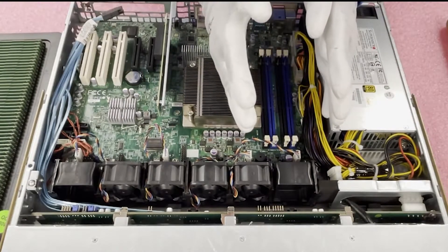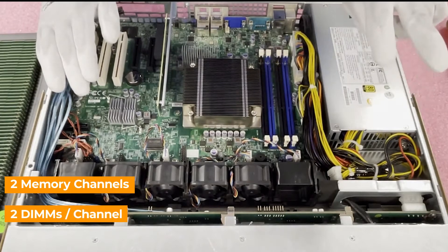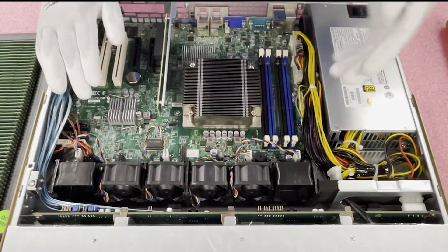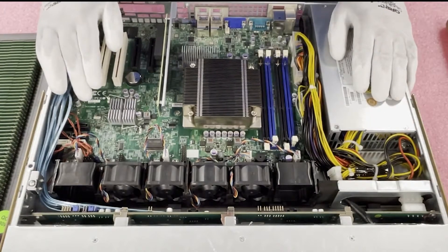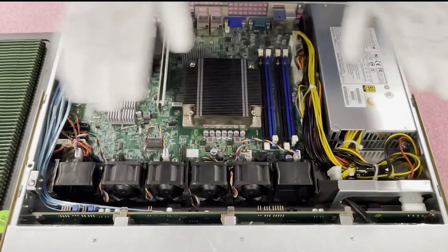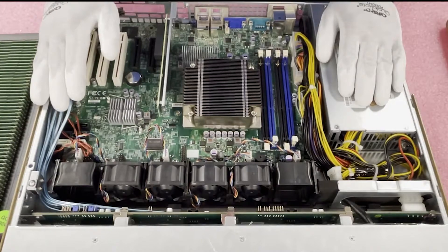Now that we're in: there is one CPU, which controls the four DIMM slots. There are two memory channels, and each memory channel has two DIMMs. The black DIMM slot is the start of each channel, and the blue DIMM slot is the second in the channel. If you're only putting in two modules, put them in the two black slots — the start of each channel. This maximizes performance by evenly distributing the load across both channels.